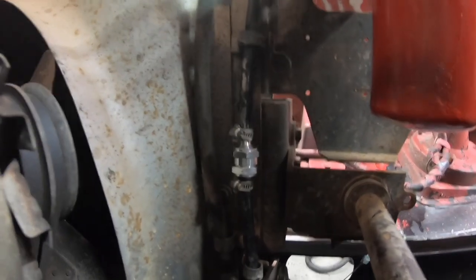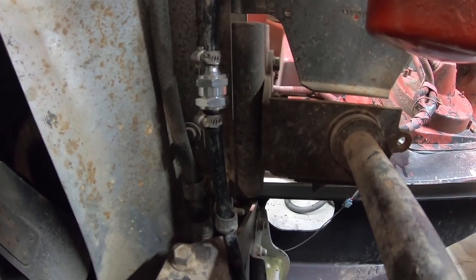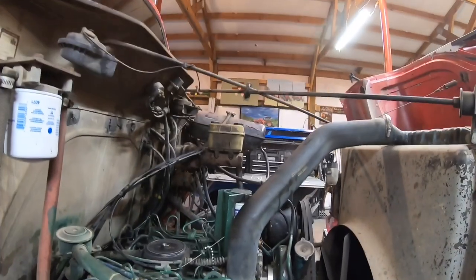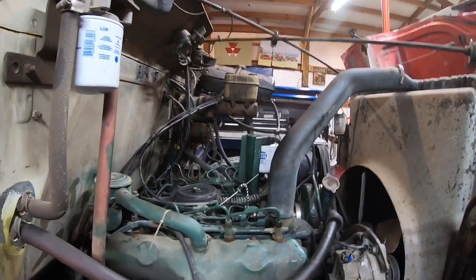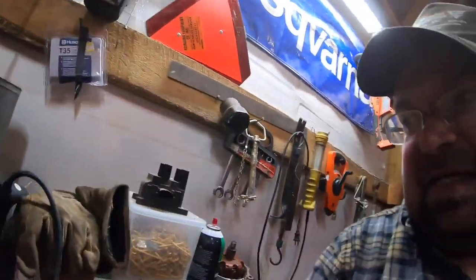I got that check valve right here, put in-line - I hopefully got it turned the right direction - and that is the line going to the tank. Controller is hooked up. I didn't change the relay because I tried it out and they're sounding like they're cycling the glow plugs. It said on that glow plug controller not to turn anything on until it's had about 10 minutes to adapt - I guess for the temperature of the coolant. Remember there's coolant when you take it out - might want to drain your coolant down before you do it, instead of being like me who didn't know any better.